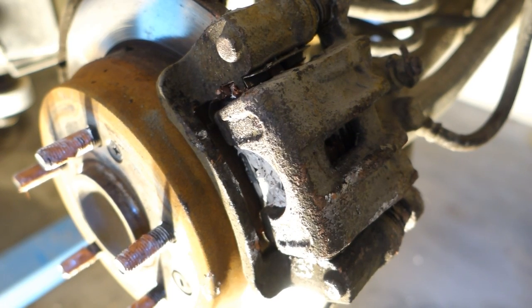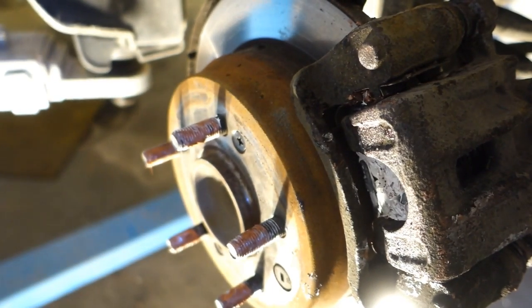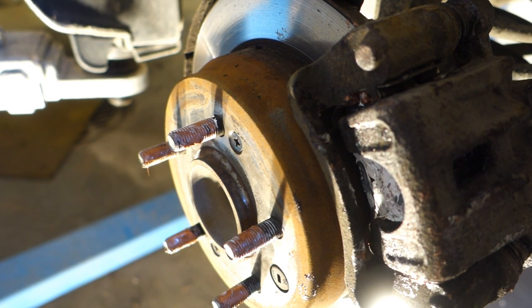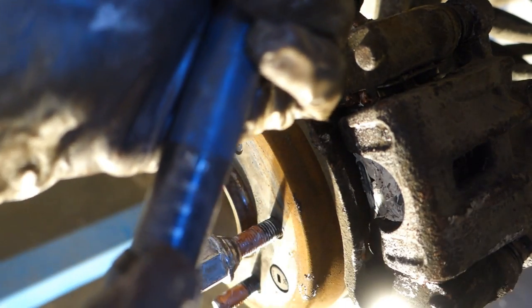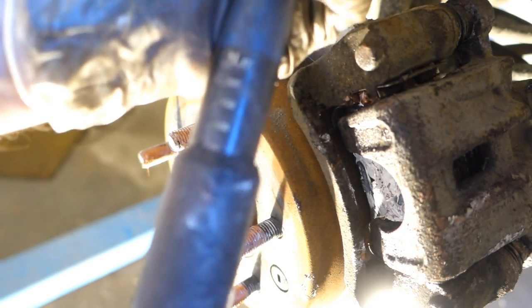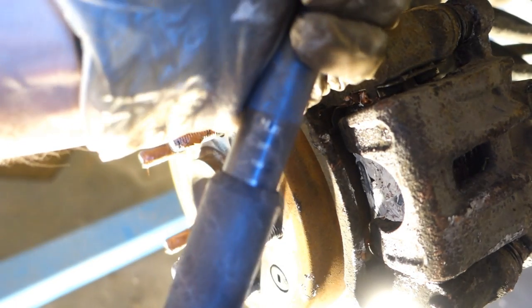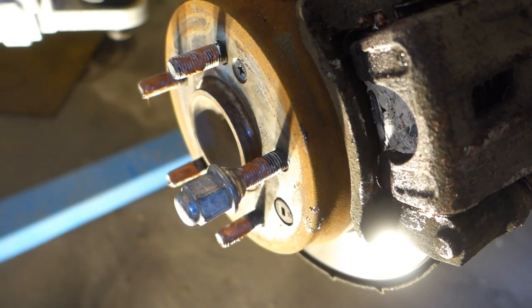that these brakes are fine, and there is now compression, and then the final step is to insert this wheel back and be sure that these wheel bolts that I install back in here, when the wheel is in here, I need to use my torque wrench again. And I need to set 100 newton meters of force here, so that these wheel bolts are tight enough. Now I rotate my tool, and this is the final step, that I tighten these wheel bolts enough.